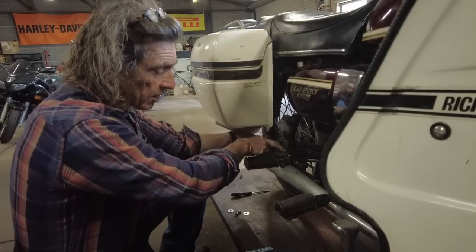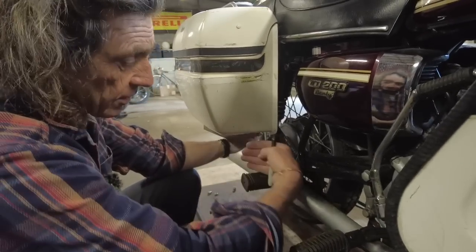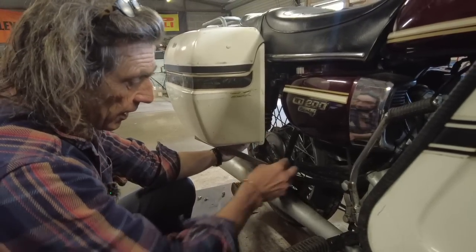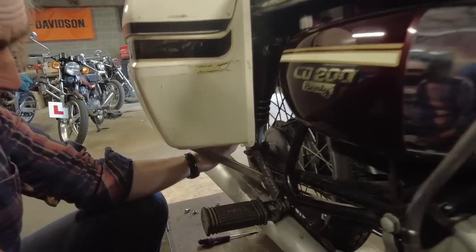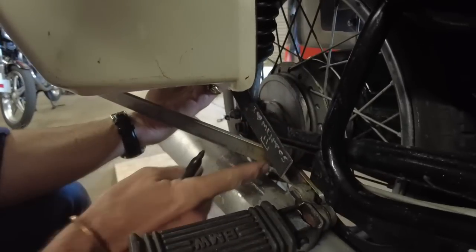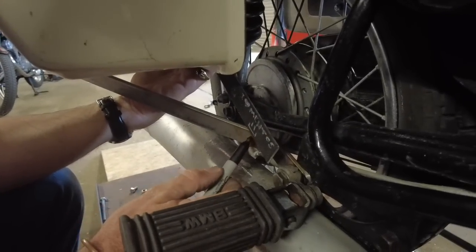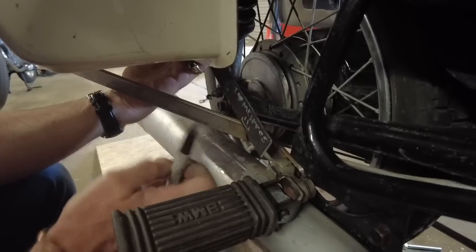Right, so there's the bend I've put in. Now, obviously, this is coming out at an angle. The back bit's coming out like that. I need to straighten it up to line up with the plate. So I've got a ruler that's roughly straight, and I'm pressing it on the plate. So that's the angle it wants to go. Hang on, let's move that back a bit. So there's not much distance on this. So if I mark that there, that's roughly where the bend needs to be, because I need to bend that in.